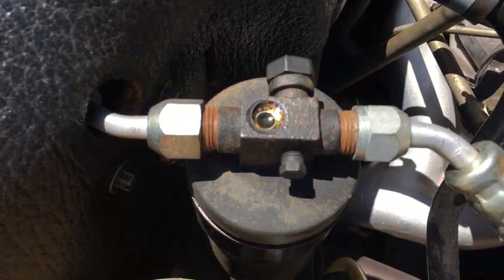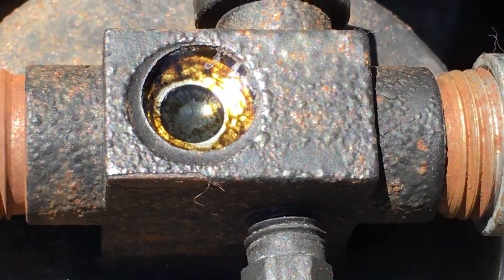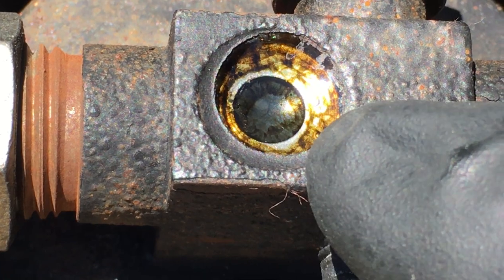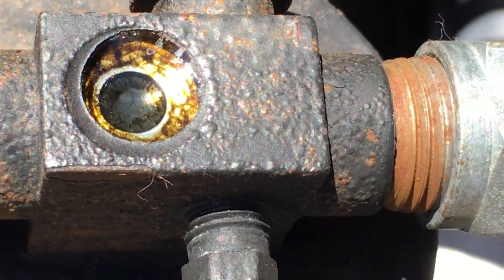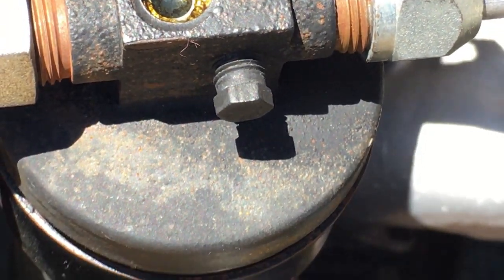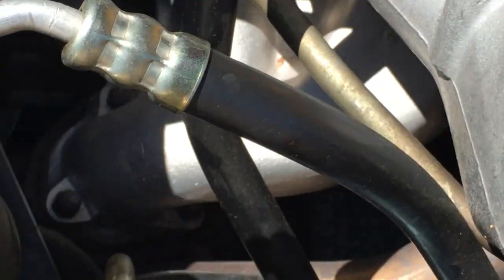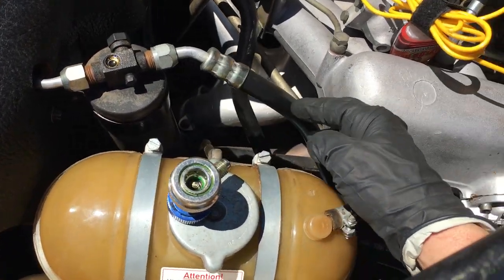If you look on the inside surface and zoom in — the dirtiness you see is not on the outside of the glass but on the inside, and there's a little imperfection in the center that's cloudy and dirty. That comes from contamination — acid content, moisture, rust, and corrosion on the inside. That's from poor practices: these systems were never really installed right in the first place, never put on a long enough vacuum even with brand-new components. Then it got serviced inside a shop.